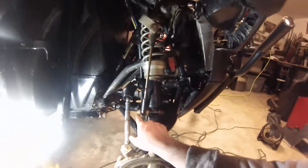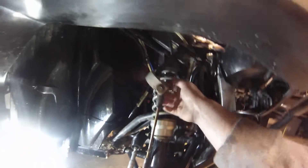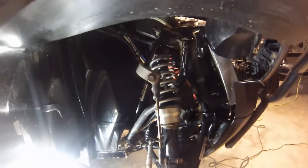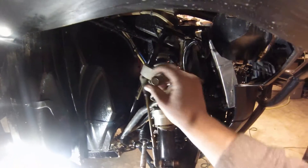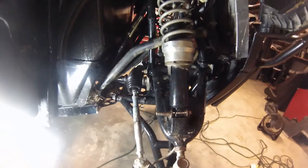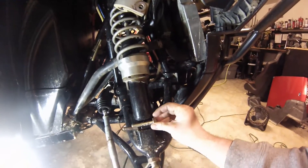The front's real quick and pretty simple. You're going to take off this bolt and this bolt, and then take off this bolt and this bolt up here. I've already loosened everything and hand-tightened it so it's real easy. You'll take this one off too — it pops off the other side. This guy pulls out — pull the sway bar out. Now the trick is when you go to put the nut on, there's all this extra space down there on the bottom.